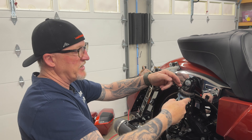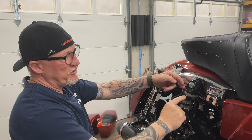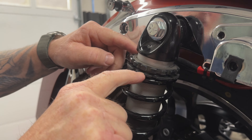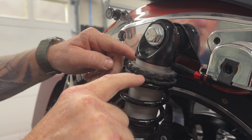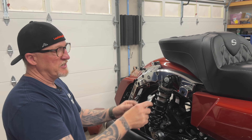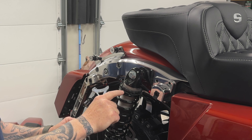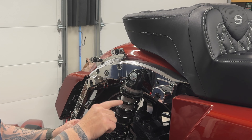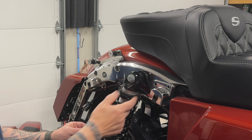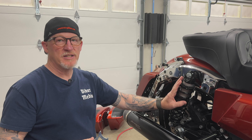The measurement you want is from the bottom of the lock ring to the top of the adjuster ring — that's the millimeter value from the chart. I'm all the way up, so I'd turn this counterclockwise all the way until it seats against it. If you do need that space, that's how you get it. Once you have the proper millimeters set, take your top lock ring, use your spanner wrench, give it a little snug, and lock it down on top. Now the preload on the right side is set.